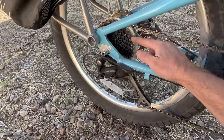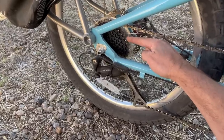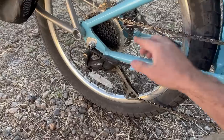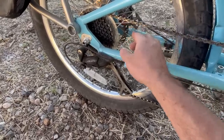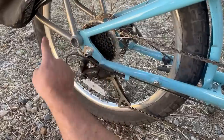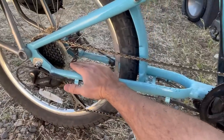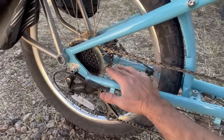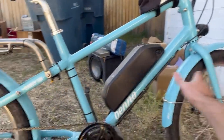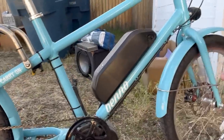This granny gear is going to be for hill climbing. Now if I were to make this a lot bigger — say I went from a 32 tooth to a 50 tooth — and this circumference was really big, I'm going to have crazy hill climbing, crazy towing ability. I could probably even make this thing do a wheelie, and this is a very long bike which is very difficult to do usually.